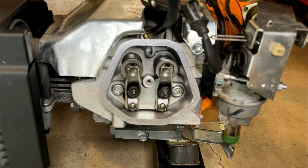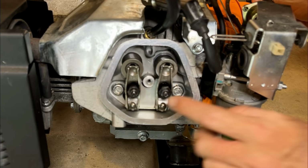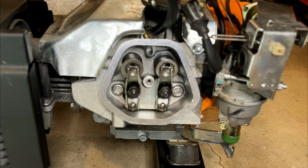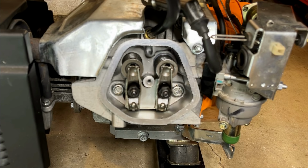So there, the exhaust valve is open. Keep going. Now the intake's open. When the intake closes, that's the compression stroke right here. If I keep pulling it, you'll see the exhaust valve just move a tiny bit right there. And that is the compression release. So if this valve is too tight, then it's going to let out too much compression. And if it's too loose, it's actually going to keep too much in and make it hard to start. So it's a very small window in order to get that compression release